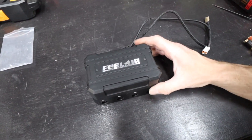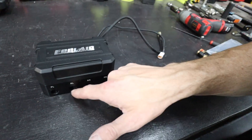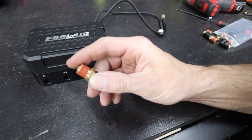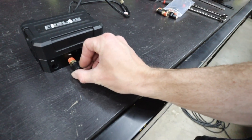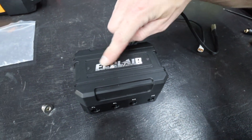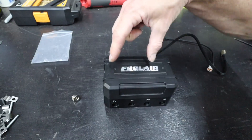This is the Feel Air manifold, and it's new to me since I'm more used to the AirLift 3P and 3H systems. This came metric thread, and since Bag Riders sells to people in America who wouldn't be able to find metric airline or metric air fittings, Bag Riders made these custom brass adapters — metric thread on one end and an American PTC fitting on the other. So it's a quarter-inch PTC fitting on one end and the appropriate metric thread pitch to thread into the manifold on the other. We've got a couple elbows and four straights. Also, much like the AirLift 3P manifold, this little cover with the logo on it is removable — so we're going to take that off and laser cut and laser engrave a custom Ludwig's Garage one.